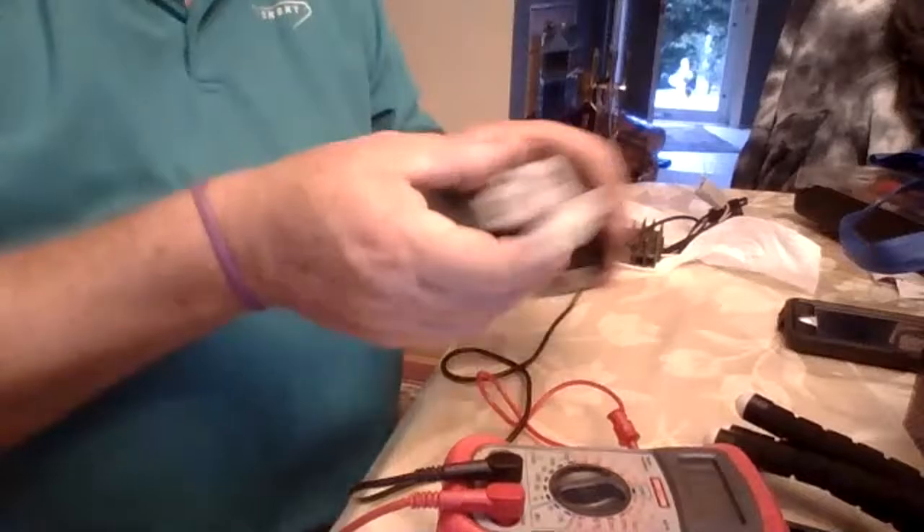Here's the new one. We've got the output which is the orange and black wire — that's the DC output, should be at least 12 volts DC. Then I have the inputs which are the two yellow wires — those are the stator outputs. Then there's a red wire and a black wire powering the PTO wiring, going out to a capacitor. The big plug actually powers the PTO through a 15-amp fuse. When you flick the switch for the electric PTO, it overcurrents for a split second, and the capacitor handles that surge instead of a fuse blowing or wiring melting.